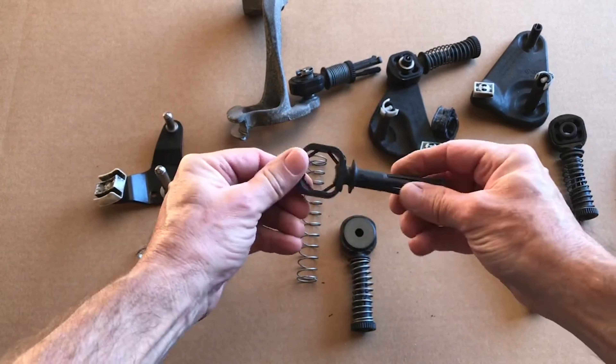A 410 shotgun brush works pretty well — it's a 12 millimeter tube — just scrub it back and forth and work all that crumbly corrosion out of there. Once that's done, the bushings will drop back in and it'll move smoothly. Once you've ensured that the bell crank moves nice and smoothly, back it out and open the cable end back up. Slip it onto the side-to-side cable — you have to simultaneously slide the bell crank into the tube, the slider into the channel, and the cable onto the cable end pin all together to prevent binding. Then drop your shiny metal clips onto the pivot pin and cable end pins. The shifter is now installed — you just need to perform an alignment.